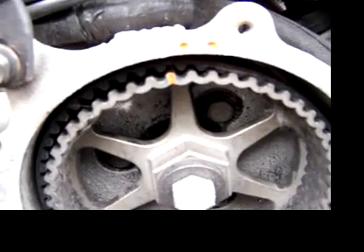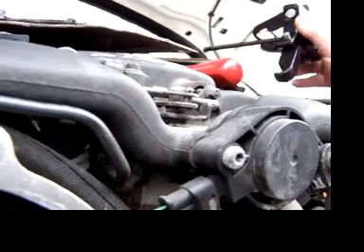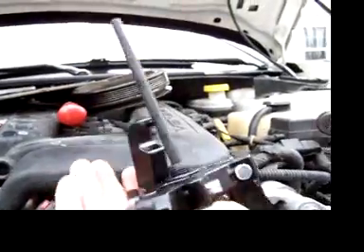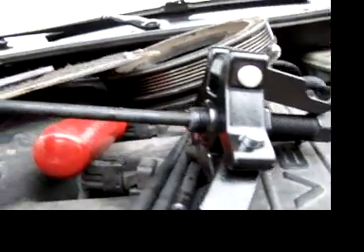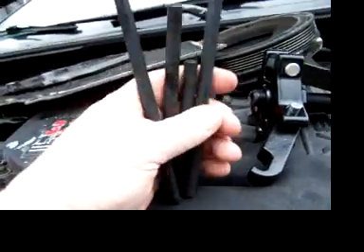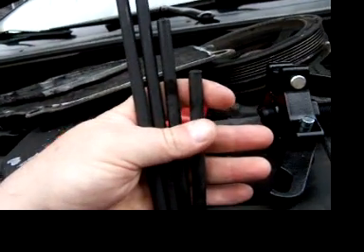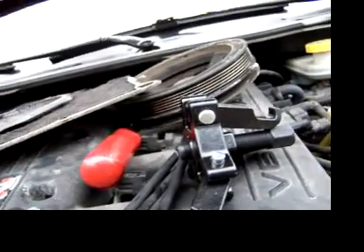And then this is the odd side. I've replaced timing chains before and had an old timing harmonic balancer puller, but with this car you need a special puller. This is my new harmonic balancer puller — it comes out like this, with different length rods. That way you don't have to take the radiator out; you can leave it in when you're pulling the harmonic balancer.